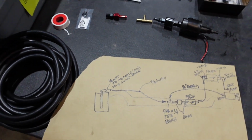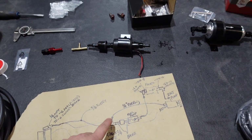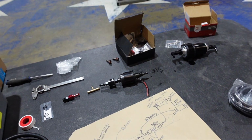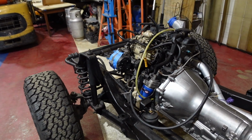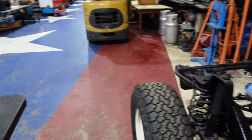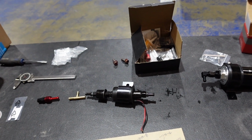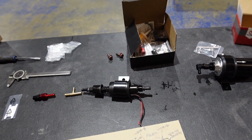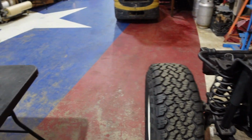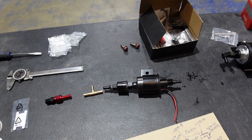Basically, from our fuel tank, we're going to run our line to a lift pump. On a Passat or a Jetta, there's something that this motor comes with. These injection pumps don't have that much pressure to pull fuel from the tank all the way to the injection pump. So we're just going to run a little carburetor fuel pump there, just a little bit of pressure to move some fluid up to the injection pump. Nothing crazy high pressure, because the pump doesn't necessarily need it to run, just for priming reasons and stuff like that. It would be a lot easier to have it in there.